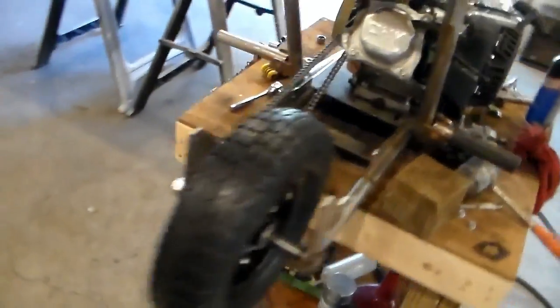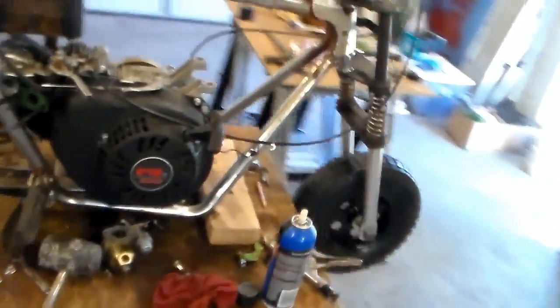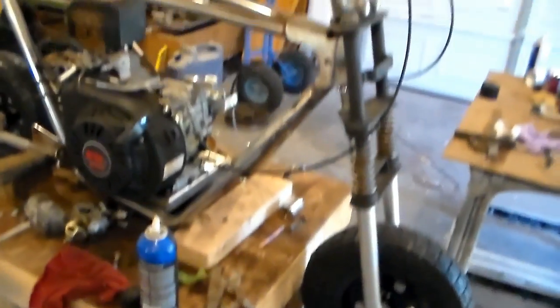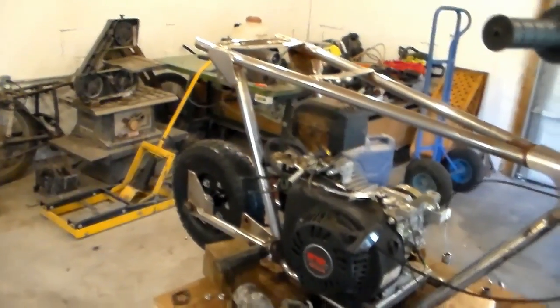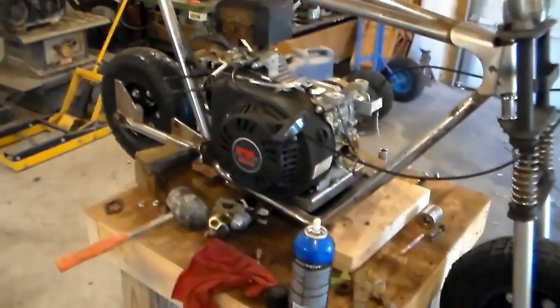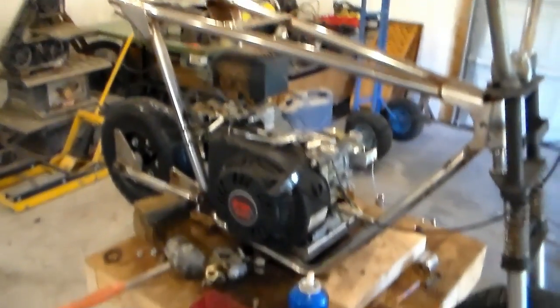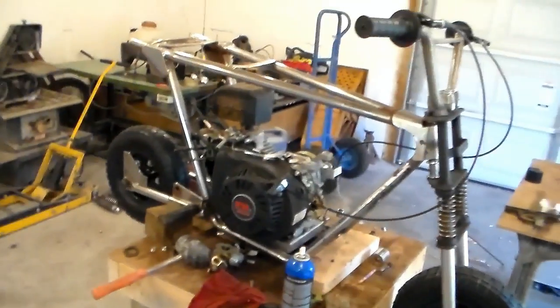So now I can turn my attention again to that gas tank. It's been sitting all day with that watered down muriatic acid in it, and see if we can get it cleaned out, because this is getting very close. Just need the fuel tank on there, do something about the seat, and hook a few things up here and there, and we'll be riding.